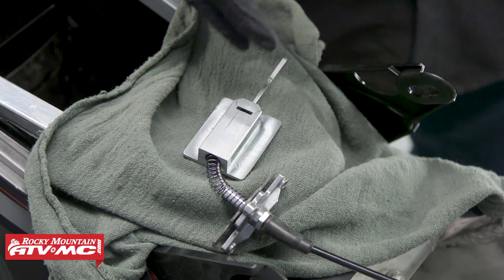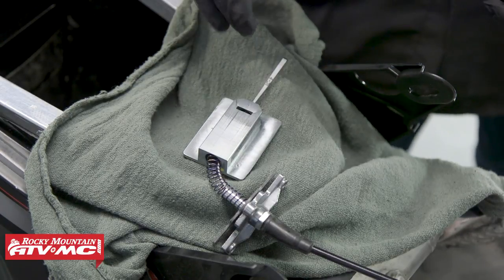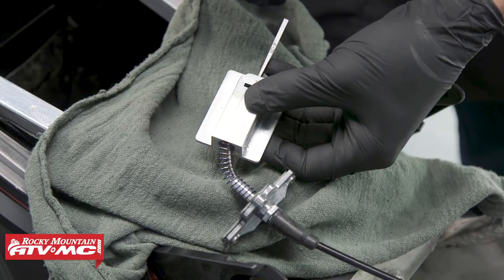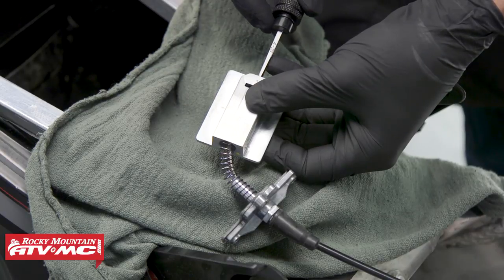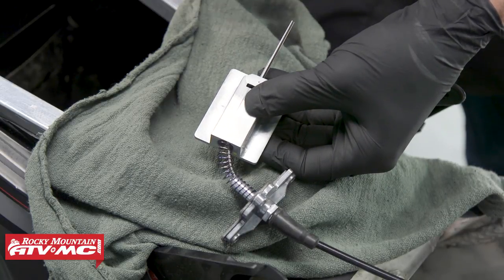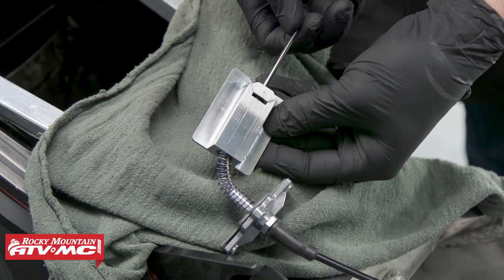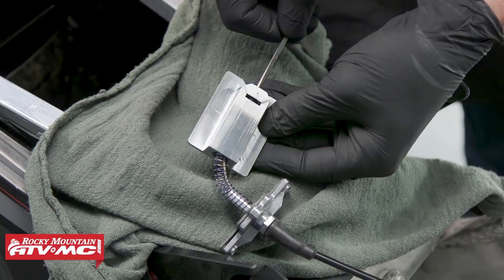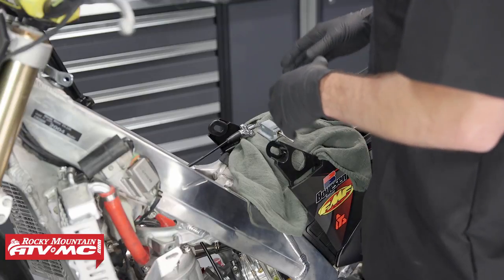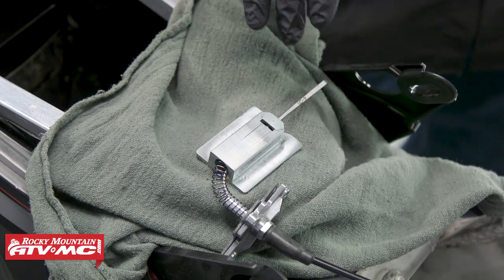Lectron says these metering rods should be adjusted within a quarter of a turn from the factory, so you're probably not going to have to mess with this. But if you do find yourself needing to adjust it: turning it clockwise is going to be richer, and counterclockwise is going to be leaner. You take this tool that came in the kit, slide it into place, and turn it in quarter-turn increments. After adjustment, this flat part of the metering rod needs to be facing the front of the bike — press up on it so you don't change your adjustment, and it falls right back into place. These things are self-adjusting and should be good to go out of the box, but keep in mind that anytime you're adjusting this metering rod, you'll probably also have to adjust your idle.